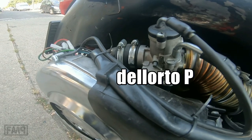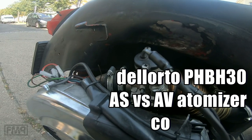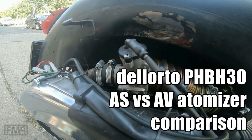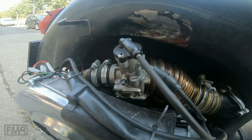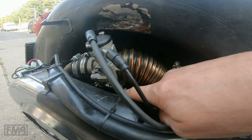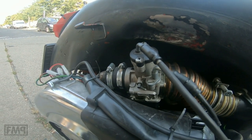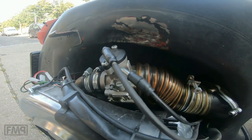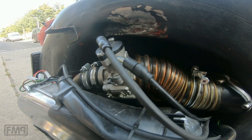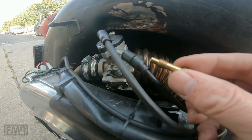And it is about the mixer tube, because often these carburettors do come with different settings or with different jets. There is a sticker on the float chamber which indicates which jets are actually in the carburettor, and some of those jets do work and some don't. So keep that in mind. Not only main jet and idle jet have to be exchanged, sometimes also the mixer tubes.